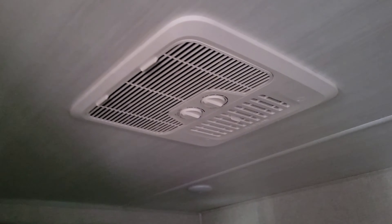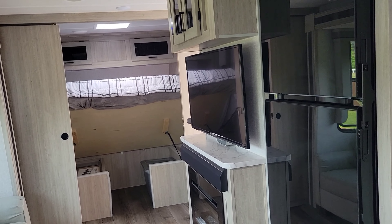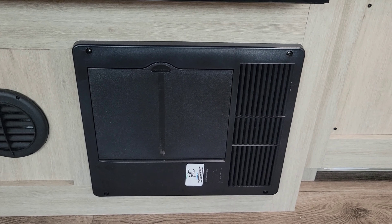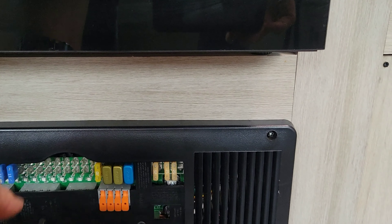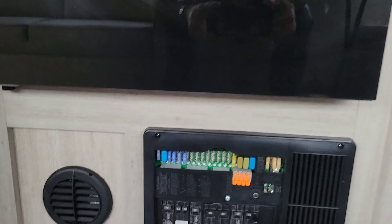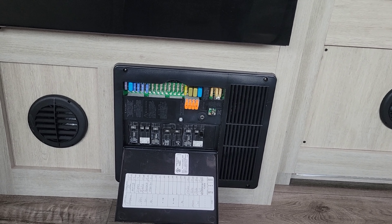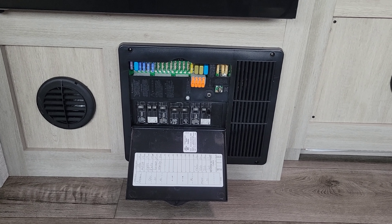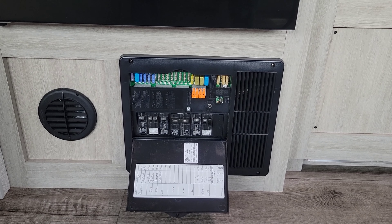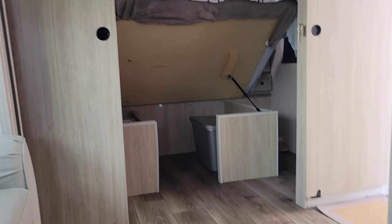Got the kid's bunk room, second air conditioner. Anybody that knows anything about electrical — you can run both these air conditioners for a decent amount of time on this one inverter running on your batteries in the middle of nowhere. That upgrade did involve getting into this box, disabling the converter which takes your 110 — I just turned it off. This required running that 50 amp plug from the front of the trailer back to this location, disabling the rear one and running another 50 amp leg of power under the underbelly and over to the front.